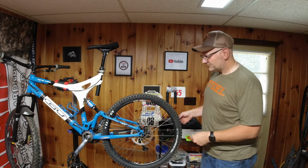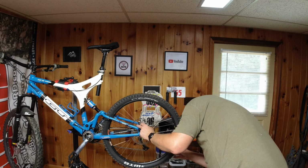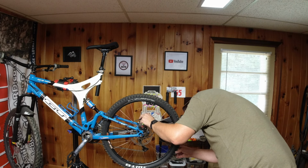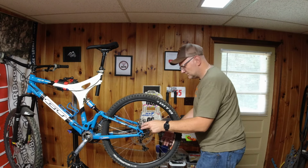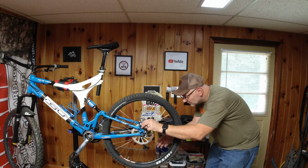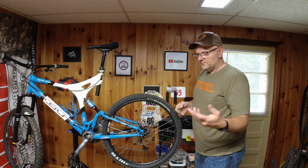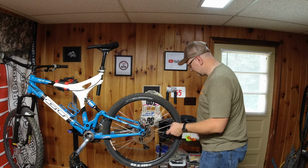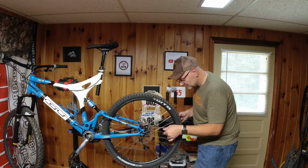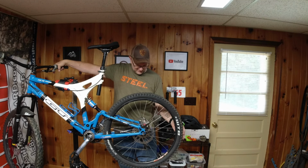Sometimes I go easy. If you watch my videos, you'll see me, boom, 1, 2, 3. Sometimes it's 1, 2, 3, 4, 5. Going back through, getting these fine tuned. And yeah, these are wanting to fight me a little bit. Let's see. And you gotta make sure your rotor's not warped either. Even brand new rotors can be warped. I mean, you've seen how Amazon packages some stuff. They'll just put them in a bubble mailer and say, here's your rotors. So you might need to straighten them out right off the bat. I've 3D printed a little wrench you can put over it. Yeah, this is nice right here. I'm going to have to bed these in a little bit to this rotor, I'm thinking.